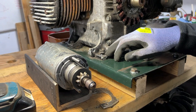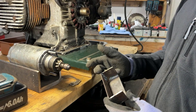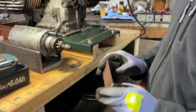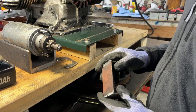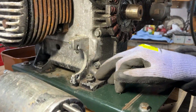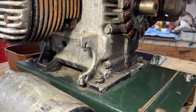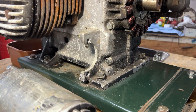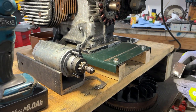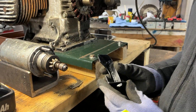We wanted to use this bolt hole as a locator to add more strength. Our original plan was to get a bit of angle iron, cut one length a bit longer, then bend these bits up. You can see we bent this bit and this bit up then welded it to make like a box — we thought that would have right angles and that would be fine. But when we tried to fit this on here we realised that these bits aren't actually at right angles to each other, because all of this is cast and casting doesn't have to be at 90 degrees. So we had to do something a bit more custom, and in the end we made it out of four different bits of metal with some crafty welding by dad, and this is what we came up with.